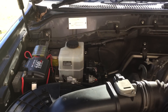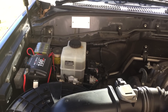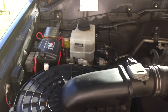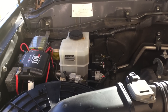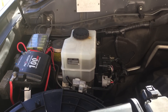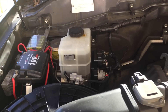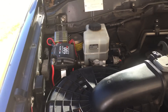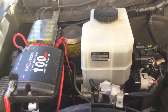If you're watching this video, you're either having an ABS fault light come up on your dash, a warning buzzer, or you have no brakes. This video is covering your ABS accumulator. If you look in your engine bay and you have a big black brake booster, then this isn't the video for you. If you look at your master cylinder and you have this cylinder here, then keep watching.